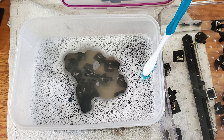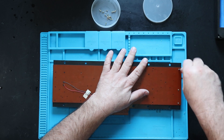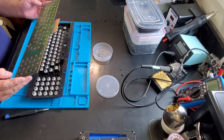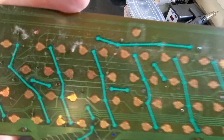I'll have to use about a half a dozen of them, at least until I can find some proper PET springs. With the keys taking a badly needed bath, we remove the 19 screws from the circuit board on the back and remove it. Besides a plenitude of dust, it's actually looking pretty good. It got wiped down with a cloth, lightly dampened with alcohol, then each contact was carefully cleaned with a cotton bud soaked in the same.